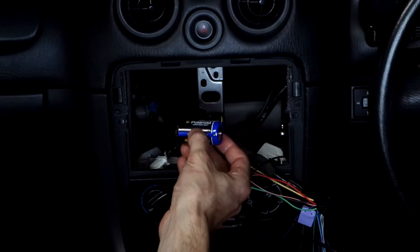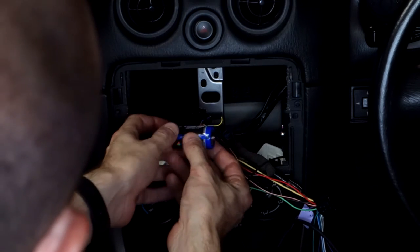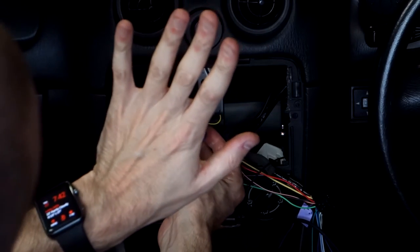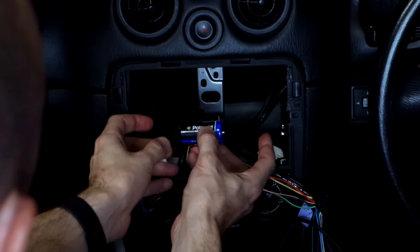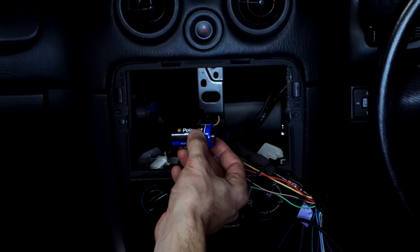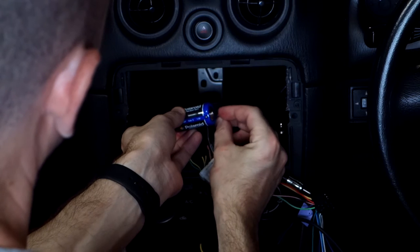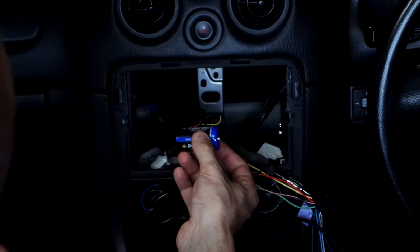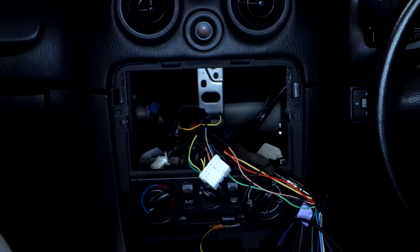When you tap the battery, if you've got the polarity correct, with the positive to the positive, the speaker will push outwards. If you've got it backwards, the speaker will suck inwards. That's a really easy way to tell, but you never, ever leave it held on there for a long time, because that's square waving the voice coil, and you'll burn it out. So all you do is tap the terminal, and that tells you that you got it right if the speaker's pushing out. In this case we know the wiring already, so we don't need to worry about it, but just in case you didn't know.